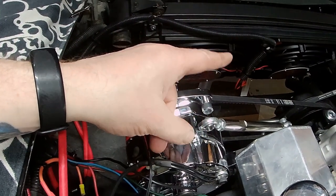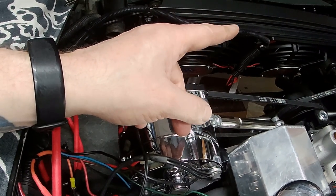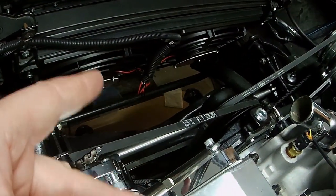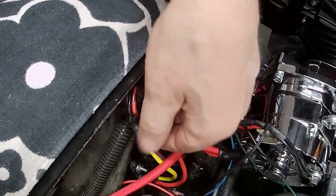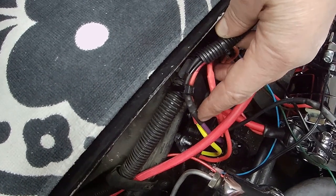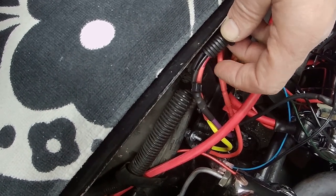I didn't like running everything back on their supplied wiring. Just for amperage protection — so I don't burn the car down — I ran two individual wires. There are four wires total, two red and two black from each fan. I ran each wire individually back through a loom to the big connections on the controller, joining the two black and two red wires to the single large wire right at the controller connection. That way I'm confident I have good amperage and won't heat up my fan wires.